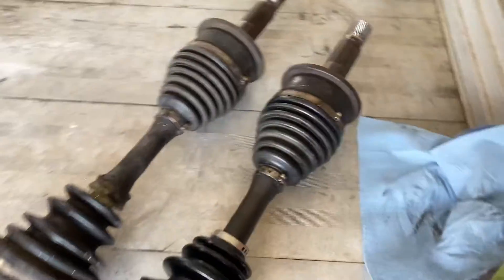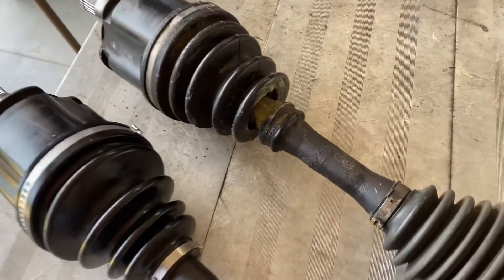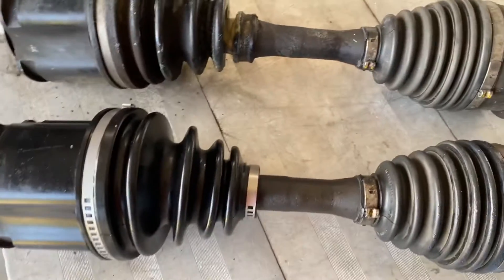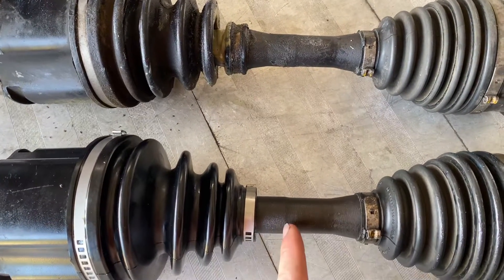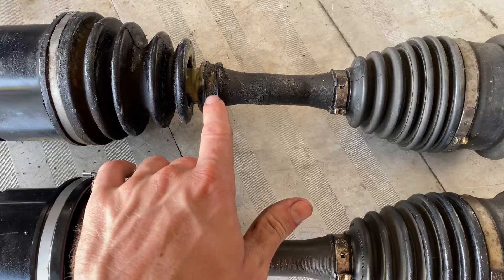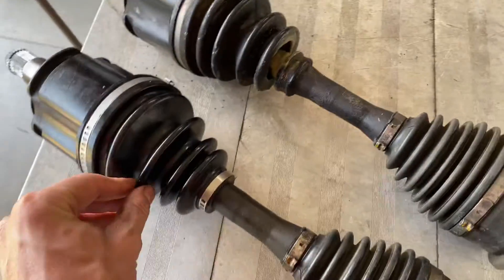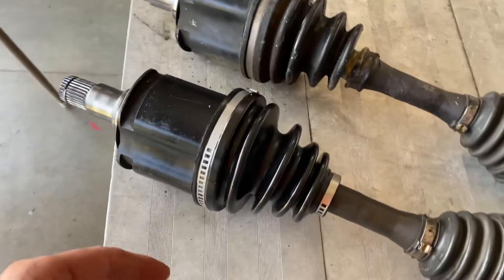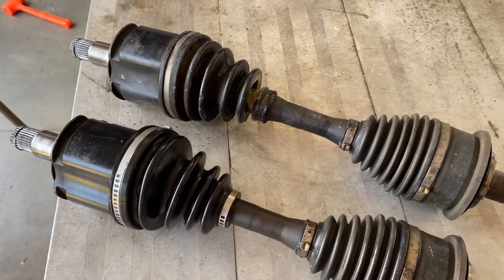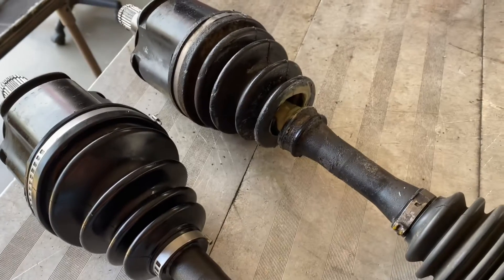So here's a little setup difference — this is the CV axle that I just replaced the boot with, and then this is the CV axle that needs replacement. Basically you keep that in there and keep the boot that way so the boot doesn't rub these ribs right here when you drive. If you don't have manual locking hubs, your CVs are going to be constantly moving when you drive, so this is a really good part of not ending up like this.